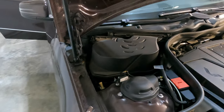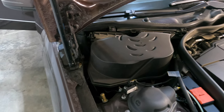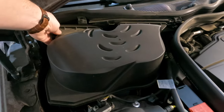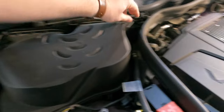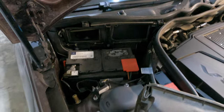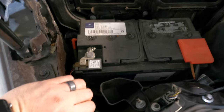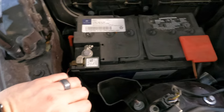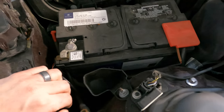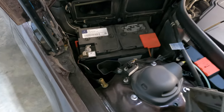The first thing you're going to want to do when you go to replace the steering wheel is unhook the battery and then let it sit for 10, 15, or 20 minutes to make sure that any excess power has drained out. The reason for that is the airbag — you do not want that airbag going off in your face while you're working with it. By draining the power and having the battery unhooked you'll avoid anything going wrong with the airbag.